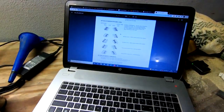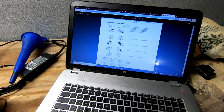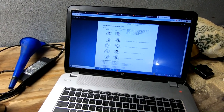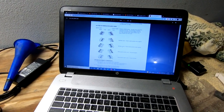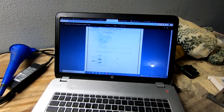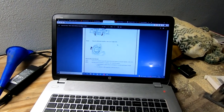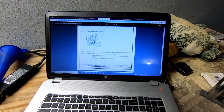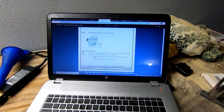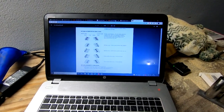But here we are. The issue we have is the driver's side heel, which is the outer gear, is all the way on the outside. Backlash correct, which I measured again just to make sure, is on the looser side of things. Ford says it needs to be 0.008 inches to 0.012 inches, so we're at 0.012 inches. It's a hair loose, but it's not too bad. It's close enough, basically. It's not going to cause a problem.